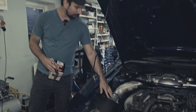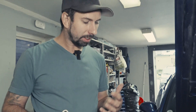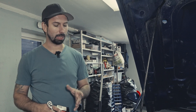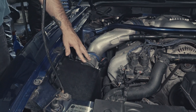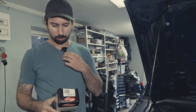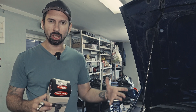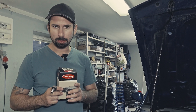If you look at my intake, it's clearly not a stock intake. But the principle is the same — it's basically the part just after the air filter that is your mass airflow sensor. The reason I'm swapping it out is because the car is kind of stalling, and I have lean codes and mass airflow sensor related codes popping up.